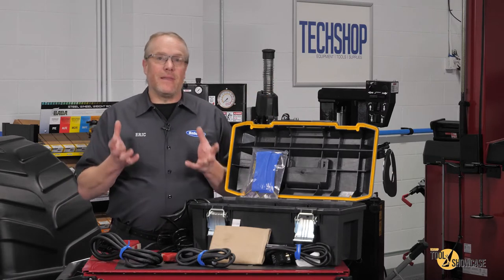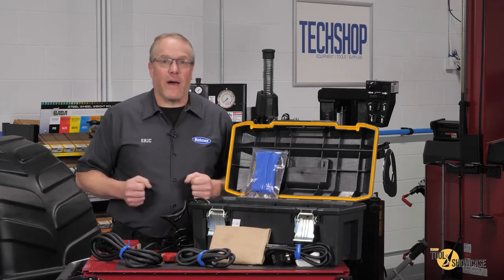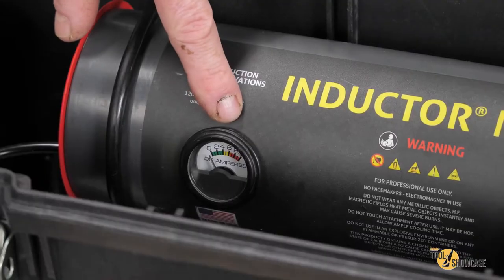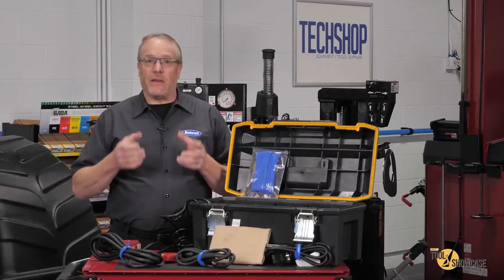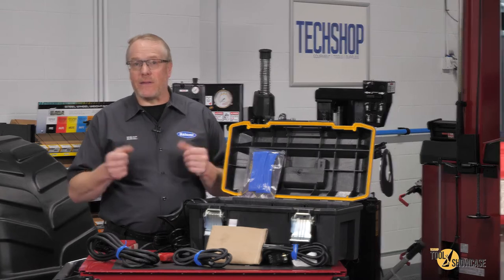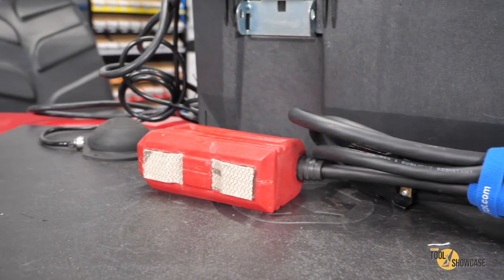As I mentioned, the Inductor Max has a maximum output of over 2,000 watts, and the unit itself features a power control knob and a power level meter. The concentrator will heat all types of hardware red hot within seconds and is also useful to remove body caulking, seam sealers, and hail dents. The glass blaster is designed to remove bonded glass, metal bond adhesives, and even spray-on bed liners.